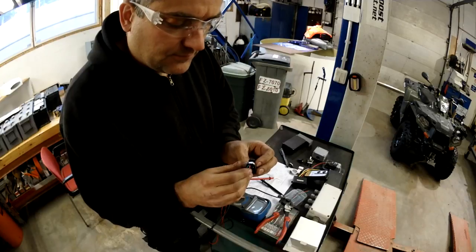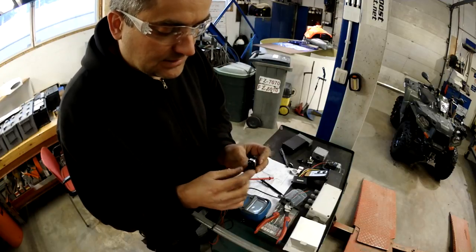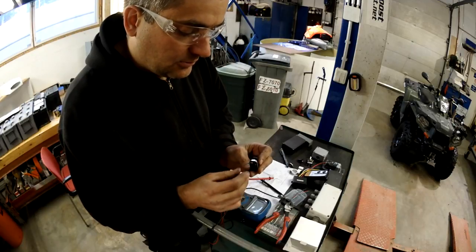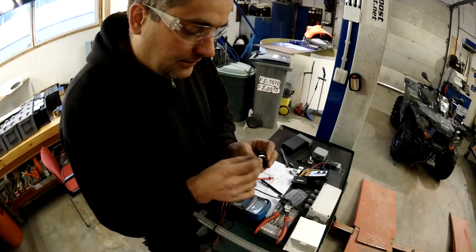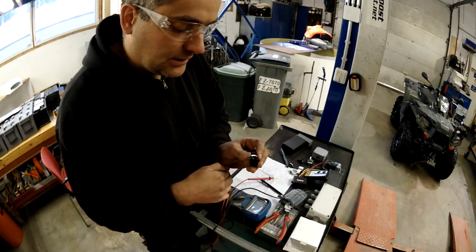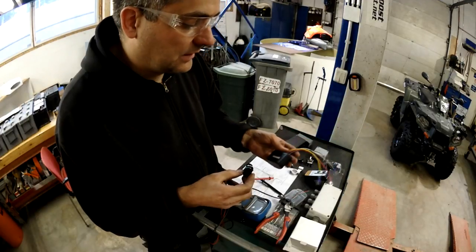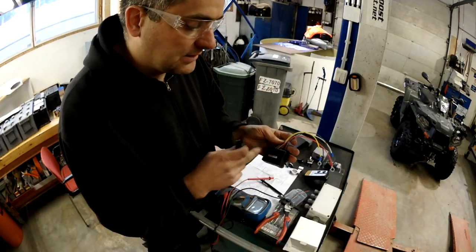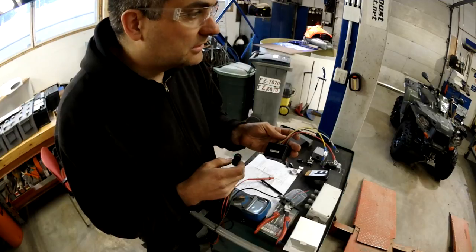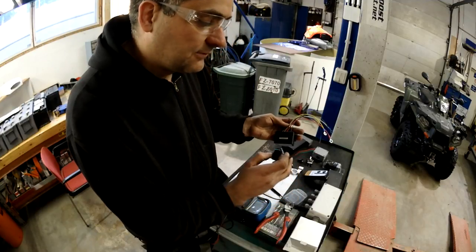So the red wire is the middle one that is then with the switch divided to either one of these, to the black or to the green. So if I'm lucky, then this red wire has also the voltage in it when the machine is on or the power is on. I can steal that same power for this remote receiver, so have to check it from the ATV to measure the voltage, if there's a voltage or not.